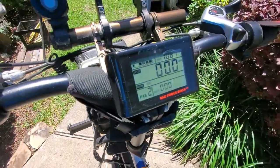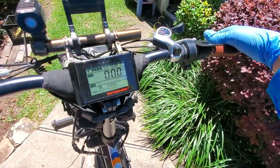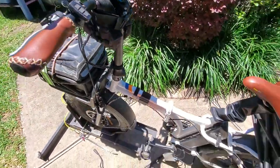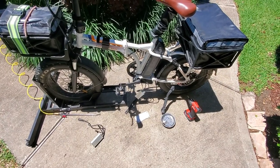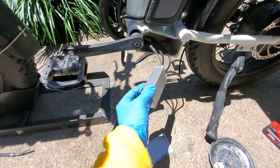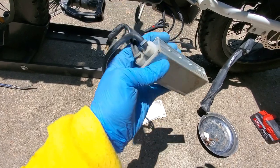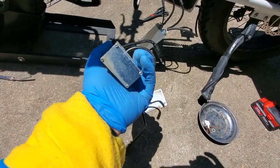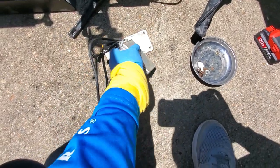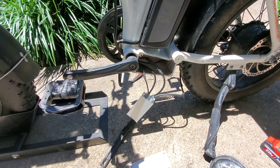Showing full bars. Pedal assist down, pedal assist up. And also the throttle is working. I guess I solved the problem. It was a warranty issue when I called Rad Power Bikes a long time ago — just never installed the controller because I wanted this one to die first. Not sure if water got into it or it's just a bad controller, probably most likely a bad controller. I may try to take this apart just for fun, but this is really small. Anyway, I'll put this back together and we'll have a Rad Mini rides again — the Rad Mini 2018 model rides again.